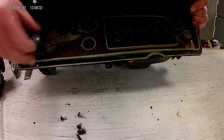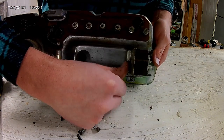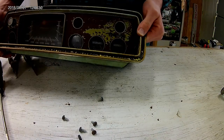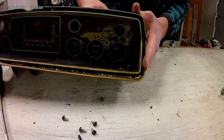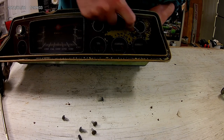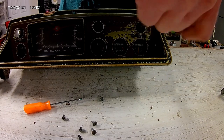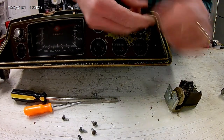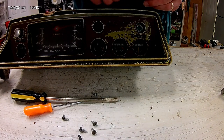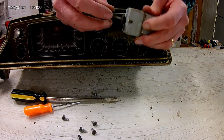Gauge cluster here - you think you need to pull that knob out somehow. Turn it around. On the back of this headlight switch, there's a button right there. You push in on your button and you can pull out on that piece. Now there's a nut right here that screws into the front of that switch. Might need a pick, might need a screwdriver. Go through there and thread it out. There it is. I'll put my nut back with it. This section with the male ends went towards the outside. Thread it back, put that back in - click. You push your button and after it's pulled, it comes in and out easy. We can clean this up too.